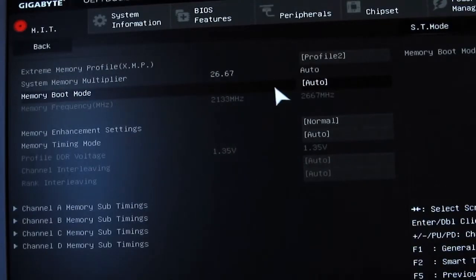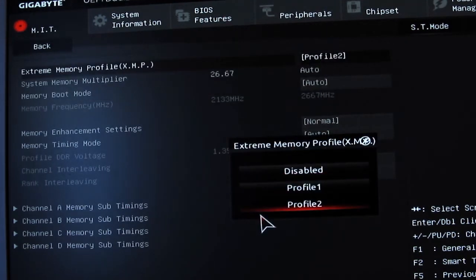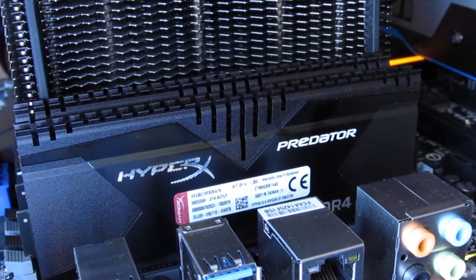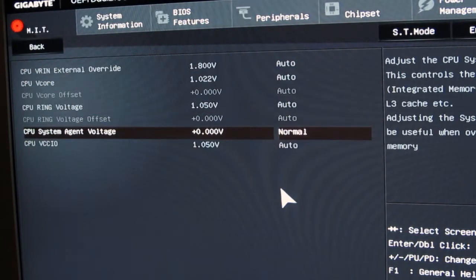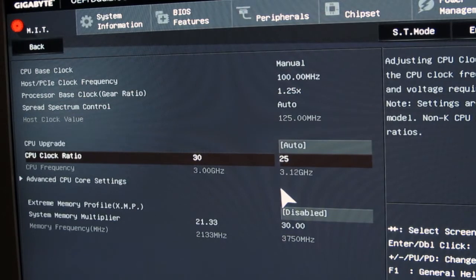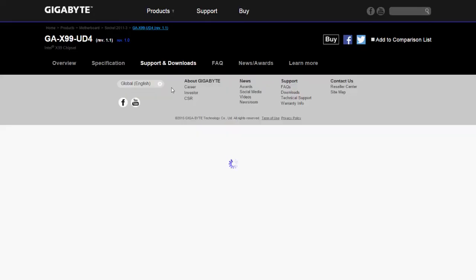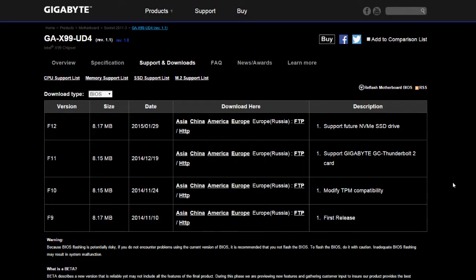Checking out the performance, we ran into what's for now a pretty common problem with motherboard and RAM compatibility, especially with the 3000 MHz speed models. We couldn't get the XMP profile working at that speed — we tried everything: automatic setup through XMP, manual setup, overclocking, tinkering with voltages, strap ratios, changing timings and latencies — everything that could be related to memory stability issues, but we got nothing. Even at 2800 MHz it wouldn't boot. Probably the only thing left to do is wait for a new BIOS, as our Gigabyte X99 UD4 just didn't comply with that speed.